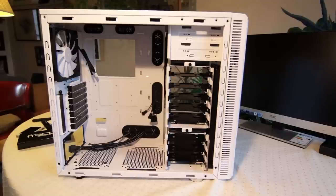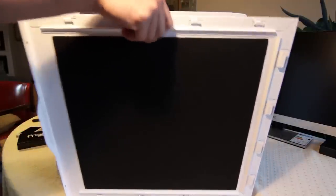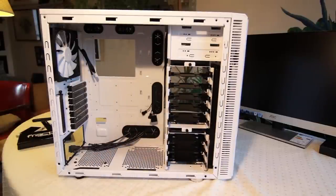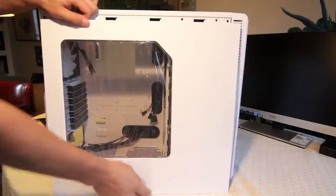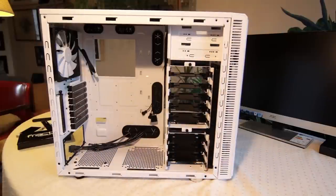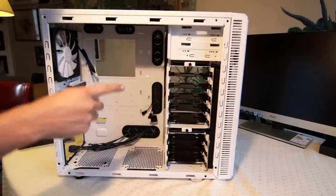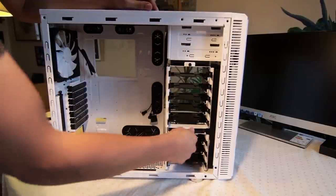Here's a look at the inside of the case — I've taken both side panels off. They're really top quality. Here's the back side panel — it's got noise dampening material on it to keep everything nice and quiet. And then there's the windowed panel going on this side — just some clear plastic on it. You can see into the case. First thing I'll get the DVD drive installed in the top, because once that's in I can just leave it and deal with it later when I start doing the cabling.